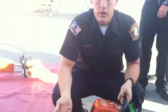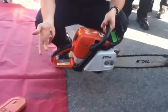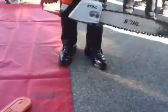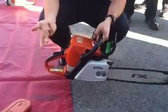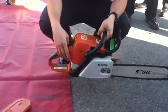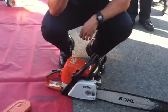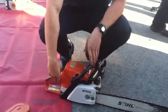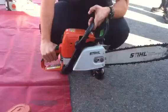Acquaintances of mine have worked in the logging industry and Christmas tree yards and have never had the inertia brake kick. The inertia brake works so that if the saw kicks back fast enough, the brake will engage automatically. This chain brake is basically the main mechanism of safety — if I'm cutting on the roof and it kicks back, that's what's going to save you from getting cut.